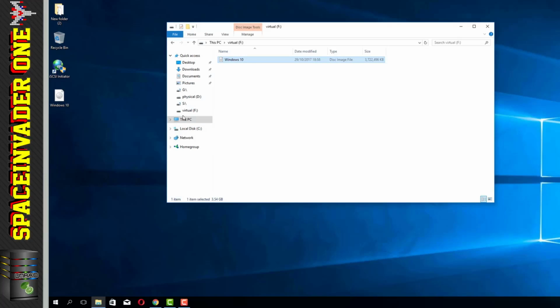So for vdisks on SSDs and pass-through physical drives, the best performance was achieved with cache equals none and IO equals native. But now I'll show you all the various tests I did with different settings on a server with gigabit Ethernet, after which we'll set up 10 gigabit Ethernet and run the same tests.